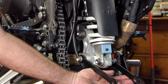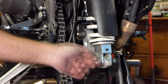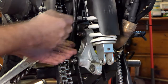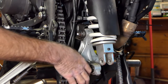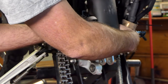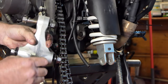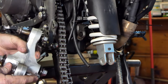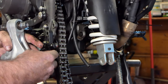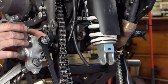With the swing arm off, these are loose now. I've got one bolt here that goes through the bottom of the shock into this link, and we've got another bolt up here that hooks the link assembly to the frame. We'll take that bolt out as well, so this will drop our link out. All three of these have sleeves that go through - the bolt runs through the center of the sleeve and the sleeve runs in needle bearings. We'll take the sleeves out of each one, expose the needle bearings, and there's a little seal on the end.